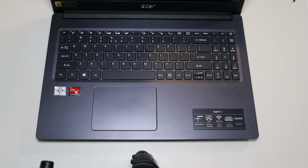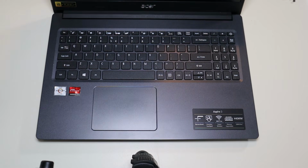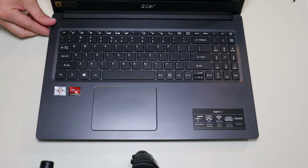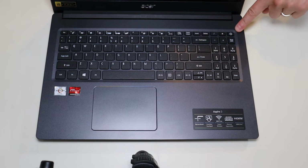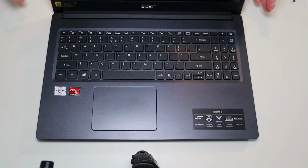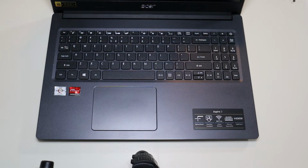After you're done that, we're going to plug both of them back in, plug your charger back in, put your battery back in, see if the computer turns on. If not, then we're going to test them one at a time. We're going to unplug the charger again, remove your battery again, press and hold the power button for 1 whole minute again. After that, we're going to put one of them back. So you can plug in your charger, leave your battery out, try turning on your computer.